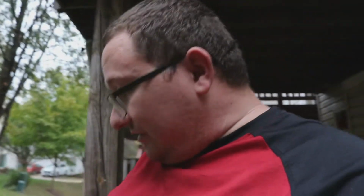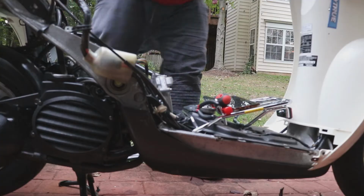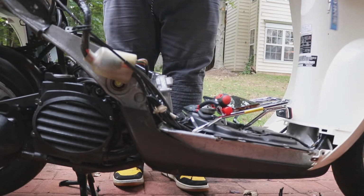Alright, so with my tools that I got from Wish, just been out here tinkering around a little bit, and the carb was entirely flooded, which is why it wasn't starting, because it's pretty much just dumping fuel into our cylinder head. So now we're gonna try and start it for the first time. I had a rather promising momentary moment like it might do something, so now is a real test. All right, everything is plugged up, keys in, put it in on position, fuel's priming.